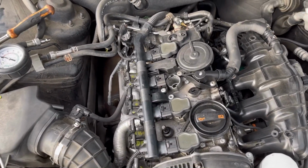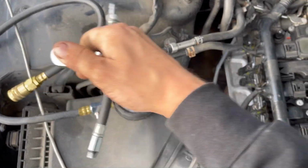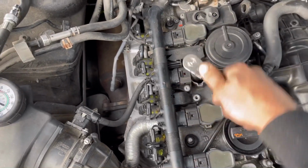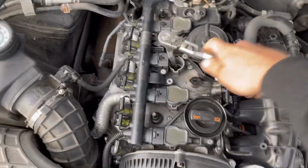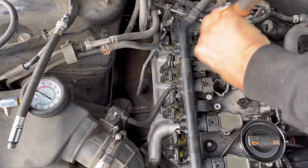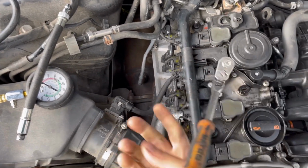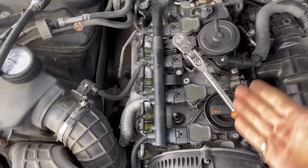So what I've got here is, I just pulled my tools out, and if you use your spark plug socket as much as me, oh wow, someone really cranked those plugs in. Not smart to over torque the plugs in aluminum heads, which pretty much every head is going to be aluminum. You can strip the threads out. Now it's getting stiff. Man, whoever worked on this thing, this is proof that whoever worked on it didn't know what they were doing.